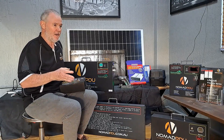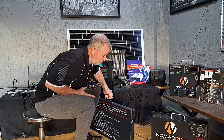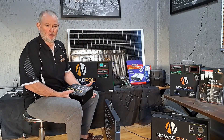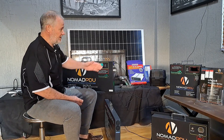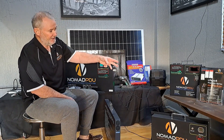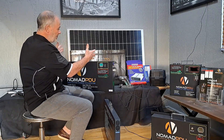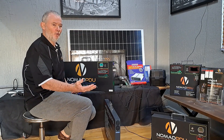So that's the 135 amp-hour battery — very slim at 48mm. It's 17.5 to 18 kilograms, still handleable. It's not as easy to carry around as the V55 and V60 cylindrical units. The cylindrical models go from 55, 60, up to 90 amp, and the 105s are cylindrical too. But the 135 has been very, very popular.